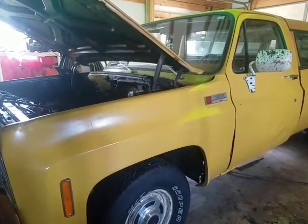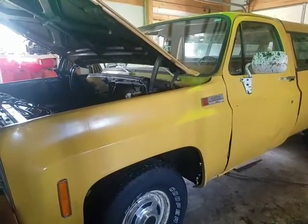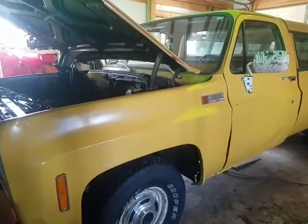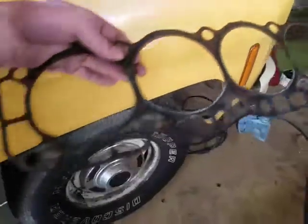So I said screw it. Some people told me it could be a blown head gasket between the two cylinders, so I pulled the damn thing apart. By some miracle — with all the times I've overheated this thing running with like no coolant — the head gasket is somehow not blown. The head's not warped, the block's fine, everything's fine. It's not blown at all.